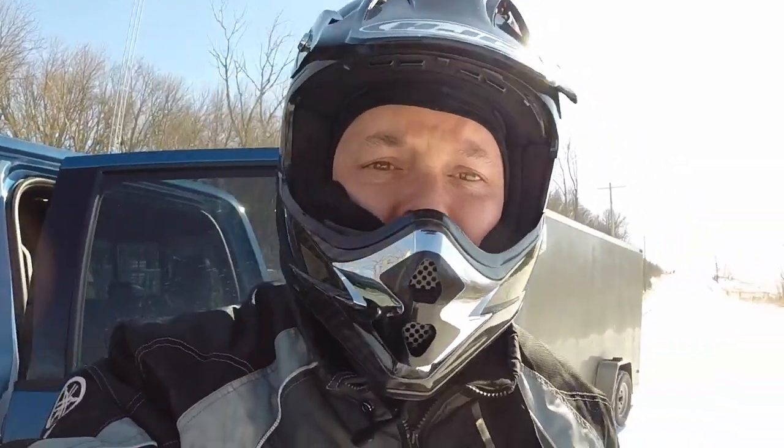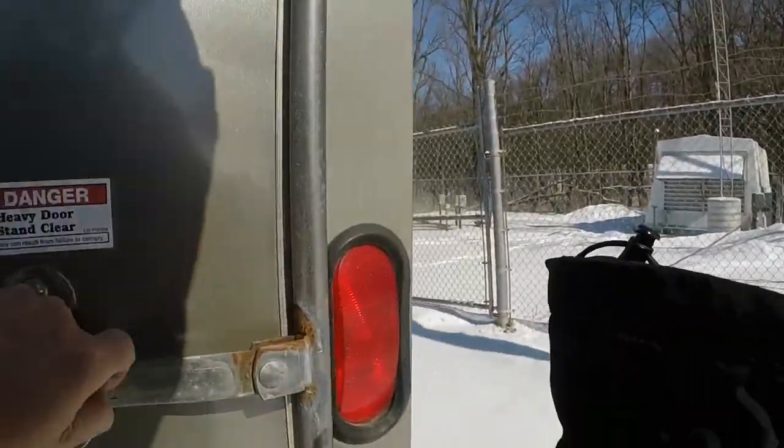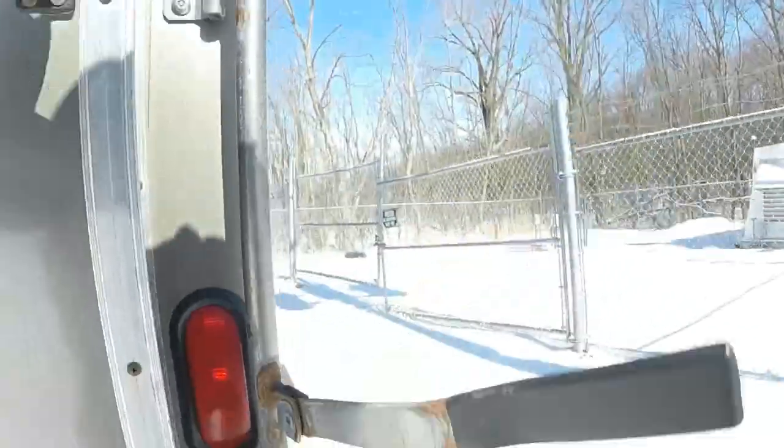Back on the lake, got the charge tube hooked back up. I drove over to the north side so I can run right down this road - I've got good traction here. I'm going to try to get two quick datalogs, check my fuel. I took out a 12% fuel trim I was holding back, so I'm expecting pig rich now, and that's what I want.